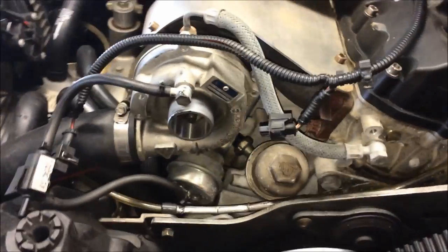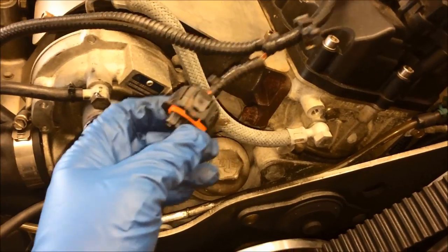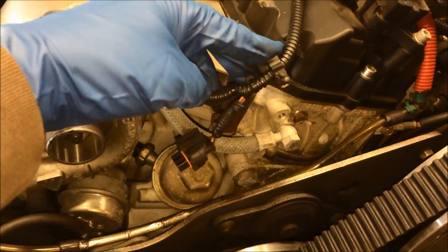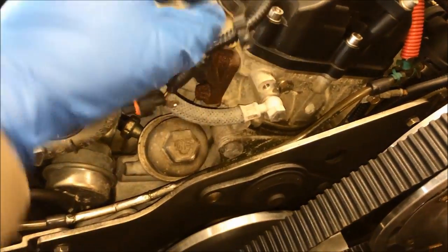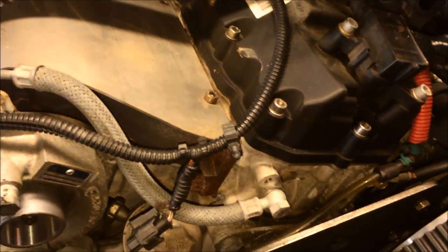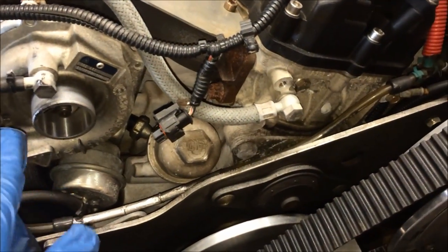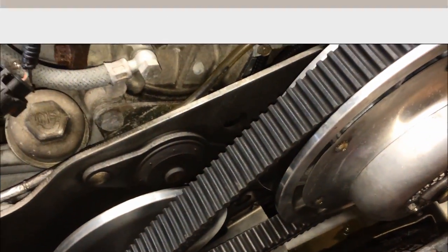Actually there's also an electrical connection on the back of the box, and there's a grommet that holds the electrical connection into the box that you have to remove. There's also a vent that goes into the side of the air box and the turbo inlet. Once you make those three disconnects and the relay, the air box comes right off.